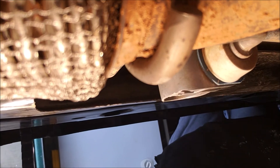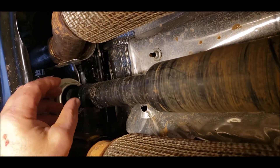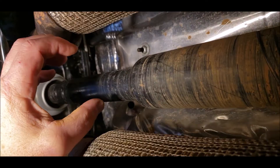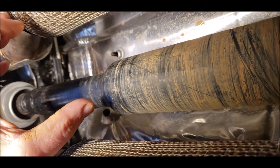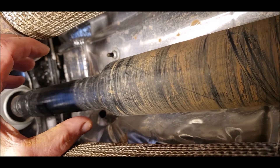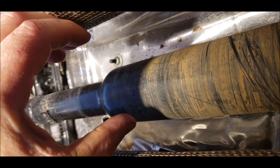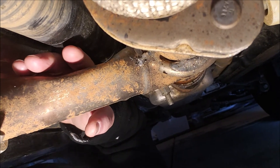Threw a lot of this stuff really well, but this exhaust system just doesn't cut it. The other thing I'm looking at — the driveline is bigger here. If we put in the smaller inch-and-three-quarters exhaust and then put an X-pipe right here in the smallest part of the driveline for more clearance, or maybe a little further over, then get aligned with the resonator back here. You want that crossover so the two sides connect, and then from behind there you run the inch and three quarters all the way back. It makes more sense to do the crossover further forward where the driveline is smaller, rather than back here where they smash this pipe down to clear the driveline.